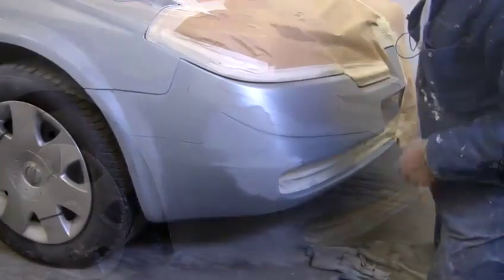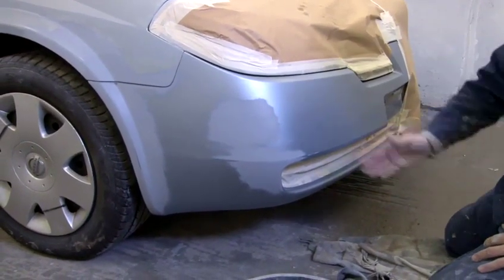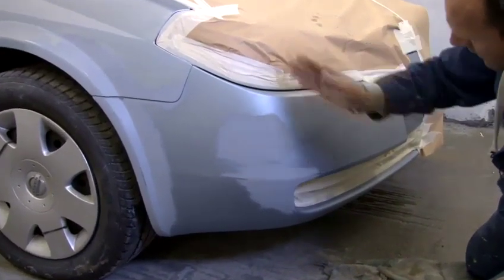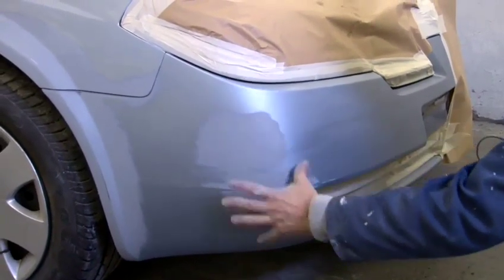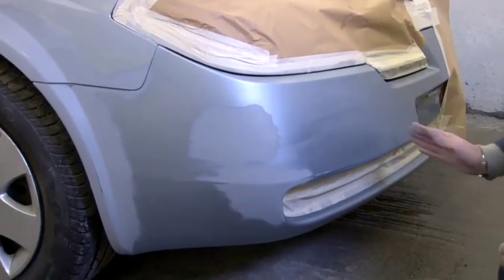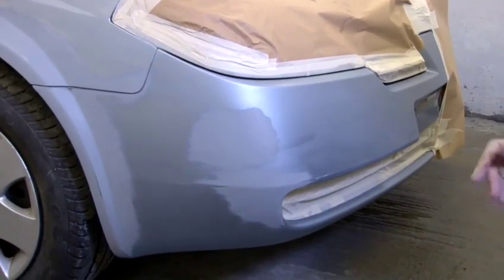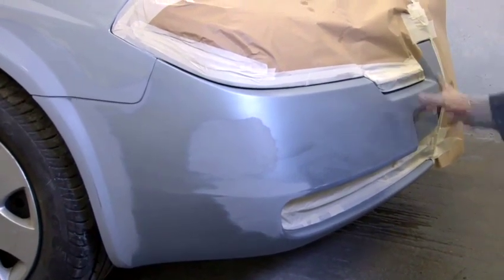It's the same theory on bodywork as it is on a bumper. The areas that are in prime, this area around here, you put your base coat colour on. You will then blend the colour through this area here. From big volumes, lots of volumes of paint, to lesser volume of paint. Feather the colour out through this area here, which you just go and you're spraying. Lighter coat and you lacquer to another edge further down, around this sort of area here.